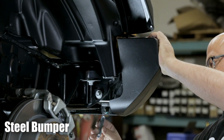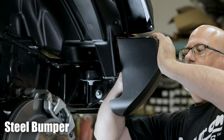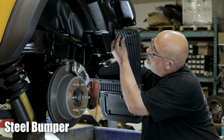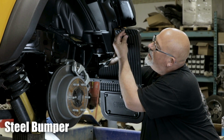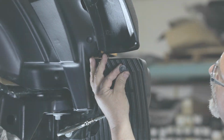This clip, with the flap removed, shows you how you can reach inside the bumper with your washer nut. With the nut in place, secure your flap to this nut using 2 sets of sheet metal screws and flat washers. We recommend you start with the top hole.